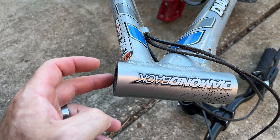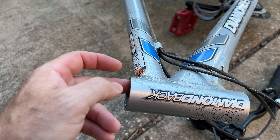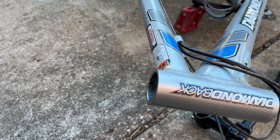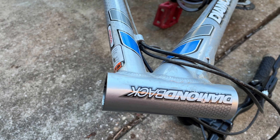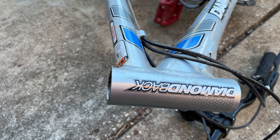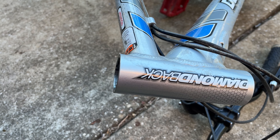What I'm going to do is use a propane torch to heat up the inside of the neck, because heat makes metal expand. I've got my cups for my headset in the freezer chilling, because coldness makes them contract so that'll make them slip in easier.